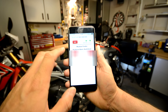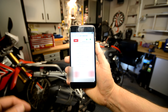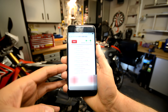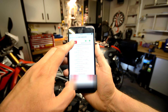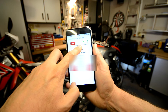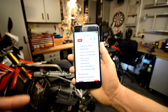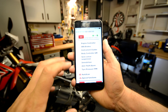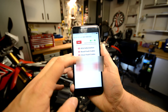If we then go back to module finder, this looks through at all the various modules that you've got installed on the bike — all the various controllers. The semi-active suspension, the instrument cluster, immobiliser, body controller, tyre pressure monitoring, ABS, and engine controller. It gives you the types of all those as well. This is information that's obviously important to somebody that's servicing your bike. If I go to Series, I can go into R series — this is all the bikes that are supported. Let's do R1200GS liquid cooled, and then it shows you all the controllers. This is where you can actually cycle the controllers if you want, and servos and things, and run tests and so on.